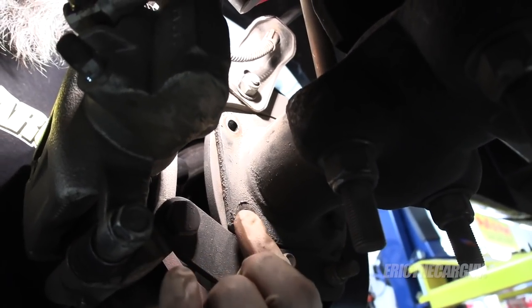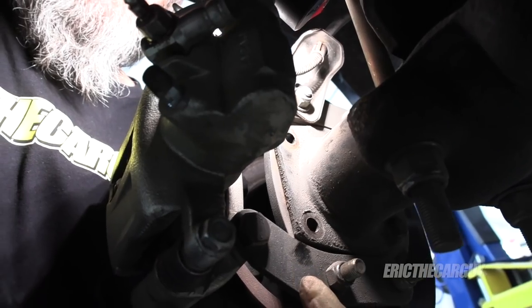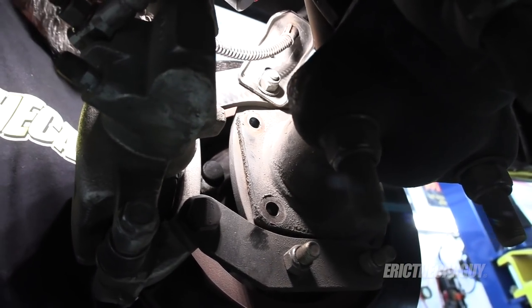During the process of doing this on my dad's truck project I found something very concerning — a few bolts that were missing that held the rear caliper bracket onto the axle housing of my truck. Now if this would have failed completely it would have been catastrophic and could have caused a lot of damage and possibly caused me to have an accident, so it's not just a good idea, it's imperative to go back and check these things.